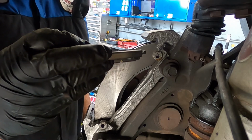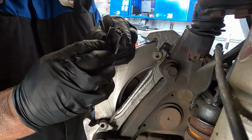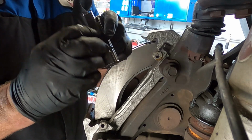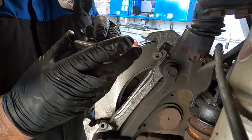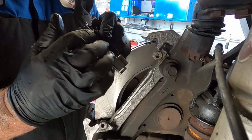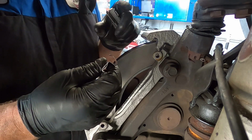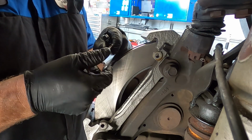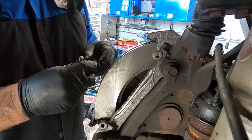It's really important to make sure that we install our pad sliders. These are what the inside of the pad is going to slide onto. These need to be nice and clean. If it comes with replacement ones like this that are the somewhat polished steel, you do not need to add lubricant to it. This is enough for those pads to slide. The lubricant can just get on and potentially damage the pads. So we'll install these and we can then install our caliper. They just clip right over as well.